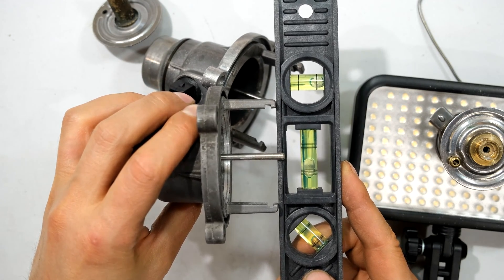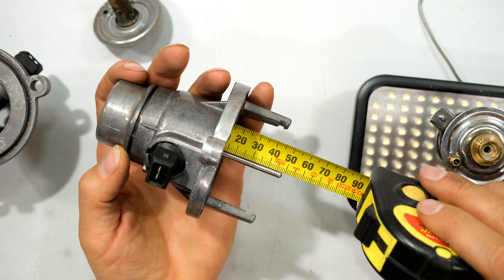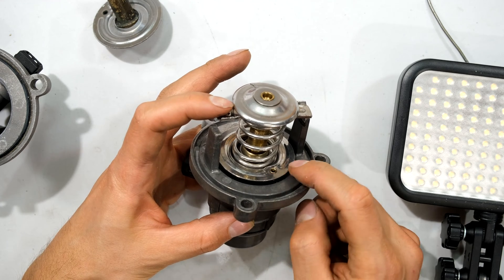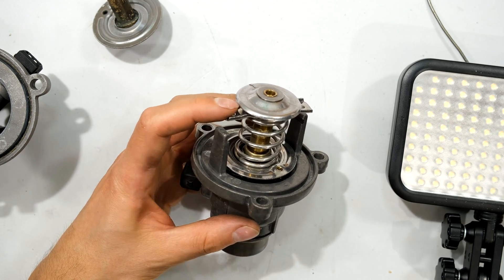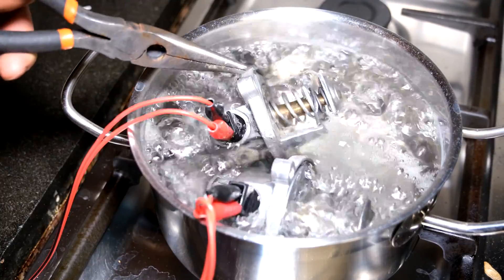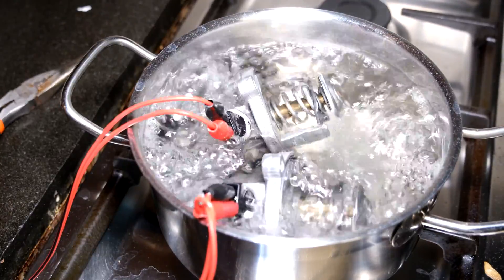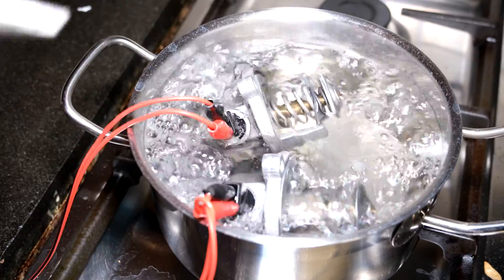Now notice how I can't fully close this — it's sitting a bit proud because all that wax is blocking the tip of the shaft. This would need to heat up to let the wax move around. This is the generic replacement and this is the original: the generic was opening at 103, the original at 105 according to my engine temperature readings, and in testing they did pretty much the same. What I've done is added a little bit more wax into the generic one to see if I can lower that opening temperature.